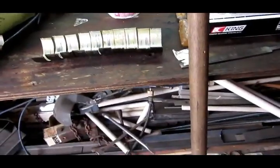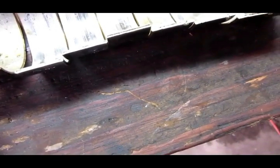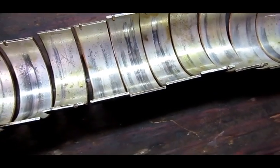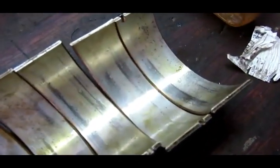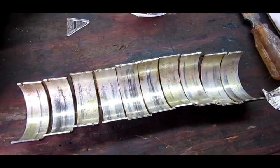I'm finishing up replacing all the rod bearings. As you can see this one doesn't look all that great - there's some lines in it, and that one there is troubling to me. I can tell you that the one in the very back was one of the bad ones, and then the front two rods were the spun ones. The third one had some stuff on it, possibly from the material getting through the front bearings into the second. But the crank itself was still nicely polished and there weren't any marks on it.